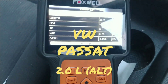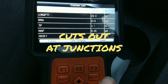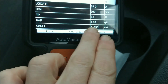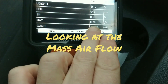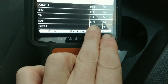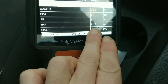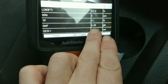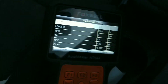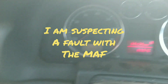On this car, the Passat, I'm looking at this because it doesn't run well in the cold of mornings. The MAF — the Mass Airflow — I've got 8.5, and that has just come down from 10. But that's at tick over; it was 8.5. With the ignition on and the car's just stalled, it's 9.2. This engine's not even running.